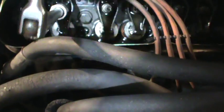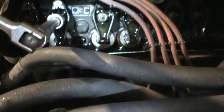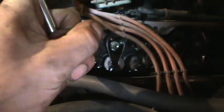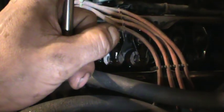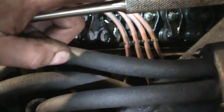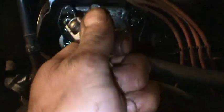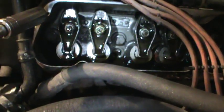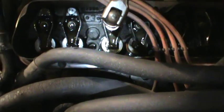Tap. That's three-quarters. That's a turn. Alright, we're starting to tap right there. That sounds quiet — now we're going to go in. I'll go at half a turn. Hear how it's skipping? It's basically holding that valve open, and if you wait a second the extra oil will pump out of that cylinder. And that's basically what you can do right on down the line. You can see the first two valves I've done — they're over tight.